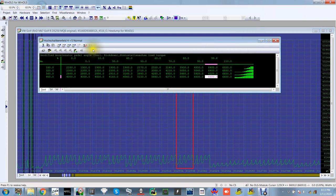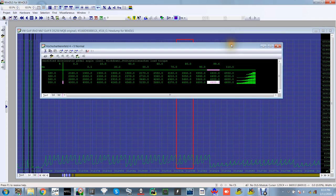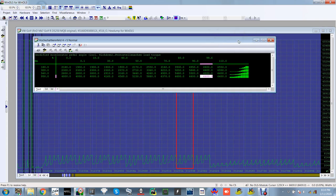Here's a fourth to fifth in normal mode map. On a DSG you always have to set the engine RPM well above your DSG shift point. If your engine RPM limit is too close to or below your DSG shift RPM, the engine will hit its rev limiter first and the gearbox just hangs there. So if you've got the engine set to 6,400 RPM but the DSG is set to change at 6,600, it won't change gear — it'll just sit on the engine rev limiter. So we'll set the engine to say 7,500 RPM to keep it well clear, then set the DSG shift point to say 7,200 RPM where we want to change on that gear.